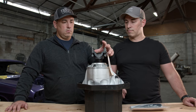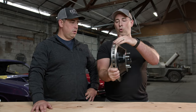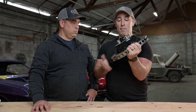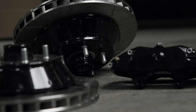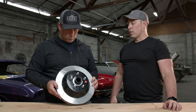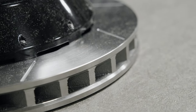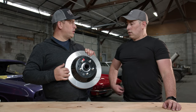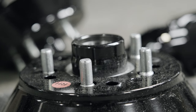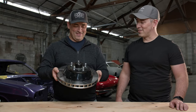I've got the new nine-inch housing — it's a bolt-in. For front brakes, I'm going with 13-inch, one-and-a-quarter-inch rotors on four-piston calipers. I'm doing manual brakes — I really like the feel of manual. I have these exact same brakes on the Mustang coupe, and you don't really need power assist with these brakes, especially if you like that road feel. These are vented and slotted — I talked to Sean at Street or Track and he said cross-drilling doesn't really add performance; it's mostly for looks.